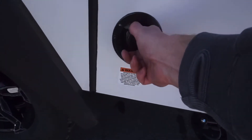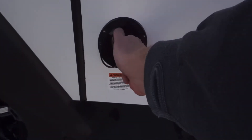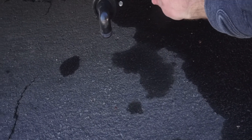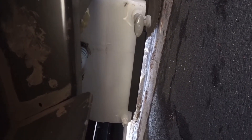And finally, if you're dry camping, this is where you fill up normal water for the 20-gallon freshwater tank. On the other underside, here's your gray water tank drain — super easy, just pull out and it drains. Got a little bit of gray water still in there. And then same thing for the freshwater drain right there — it twists and drains.